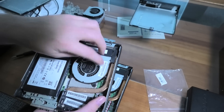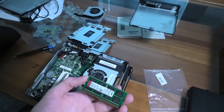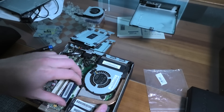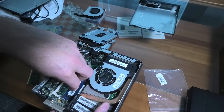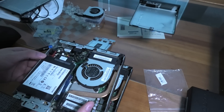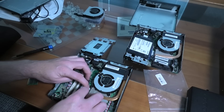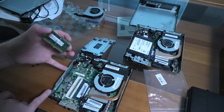So what do we have in our donor over here? That could also do with a cleaning. But up here, this one is a Kingston and it's an eight gigabyte block — that's the one we want. We also have the original Lenovo-branded RAM block here as well; we're going to leave that in the donor. Might even take that two gigabyte and put it over in this machine. That should work fine. The reason I'm doing it this way is so I'm just upgrading my machine without having to reinstall or do anything — just swapping the RAM around.